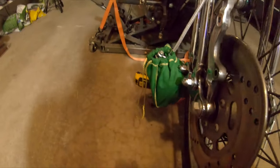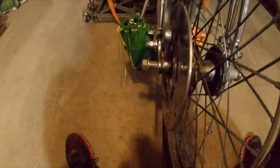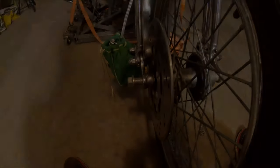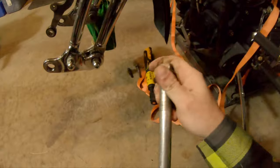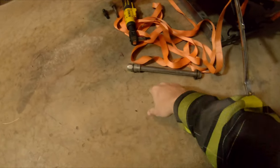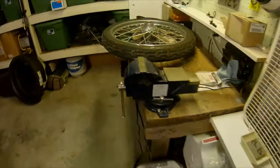Got the handy mallet, going to give it a few smacks. That was easier than I thought. It looks like we had an extra washer over here that was just chilling right there that I didn't see. We'll keep pulling this out — I'm going to need two hands, and everything's just going to get rebuilt back on this axle as it came out so I don't lose anything. Axle is out. I did wipe it down — it had a fair amount of lube on it, which I was really surprised by. It's going to go back in this direction with the spacer. I need to go through these threads with a little wire brush to clean them up — they're gummy.